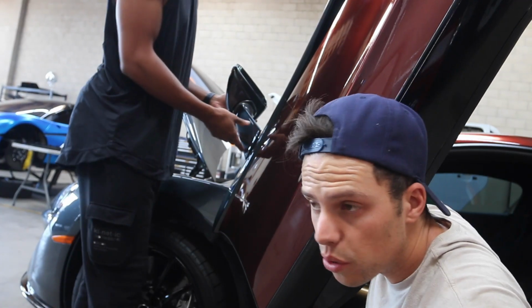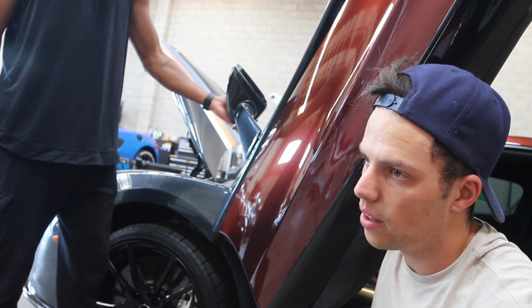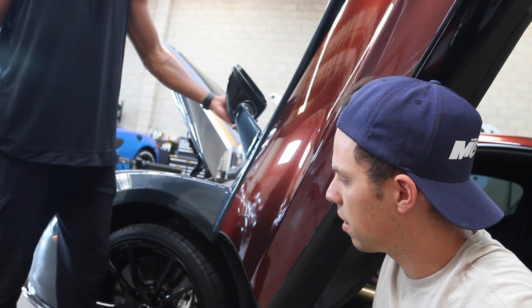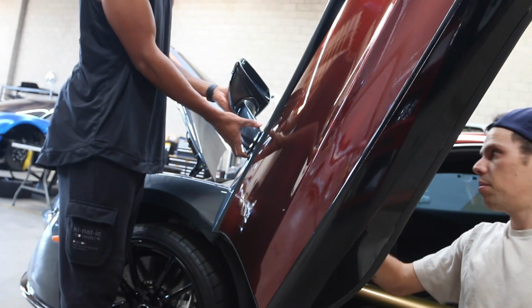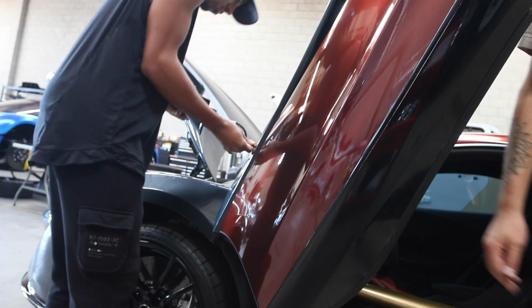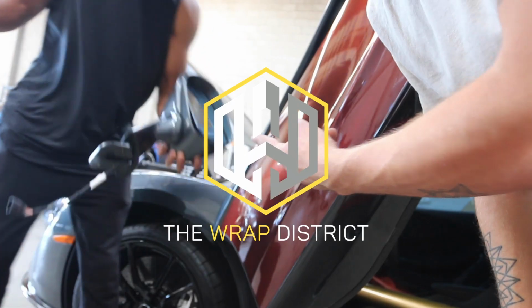I suggest to loosen the bolts with a wrench, a very small wrench because it's very tight in there, and then just enough to where you can loosen the rest with your hands. Cool, and then DJ could be able to pull the mirror out. Slides out. I already unplugged the harness as you saw earlier. And then boom, there you go. It's completely off.